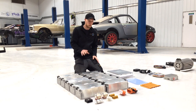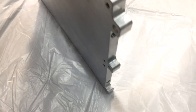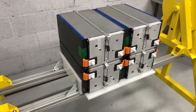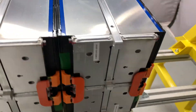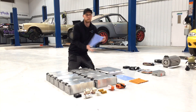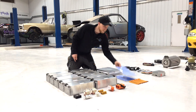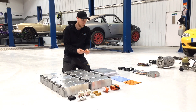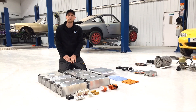The plan with our pack is to mount all 10 in one pack in the front of the car, mounted onto our coolant plates - these have an in and out. We'll have two modules on either side: three coolant plates in total, two packs of four and then a pack of two by itself. Between the module and the coolant plate we have a heat transfer pad - a sticky-back pad that helps heat transfer. Then we have our custom-made bus bars which link between each module to run them in series, as the motor we're using has a maximum voltage of 132 volts.